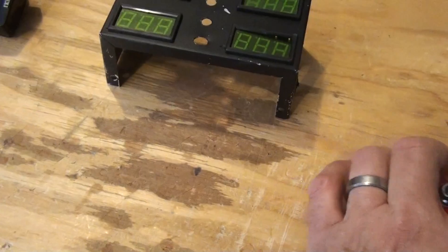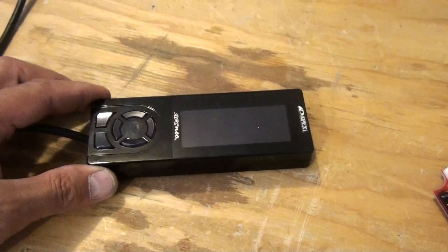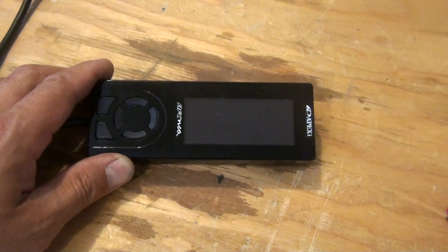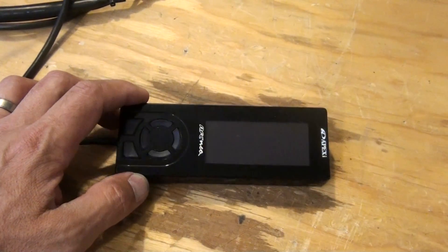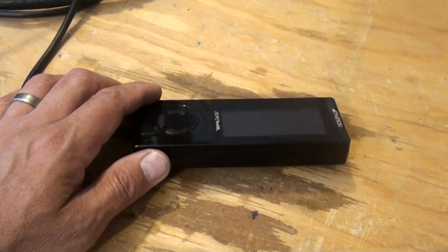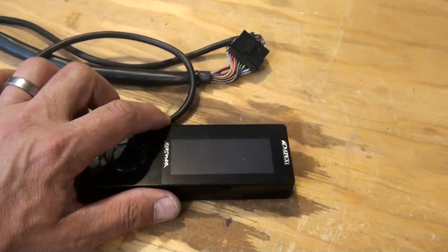So we did away with that — still using the same controllers, but we did away with the LCD screens and went to some analog screens I'll show you in a minute. The thing I'm most upset about is not being able to use this Apexi fuel controller. I spent two straight days wiring and troubleshooting it, only to figure out I couldn't use it because my truck doesn't have a MAF sensor. I connected it to the MAP sensor and it took all the readings, but it wasn't able to lean the fuel like I wanted. So we're not using that, but I do have a digital EFIE installed that I want to show you.